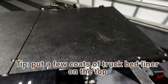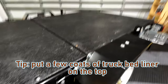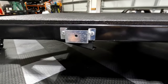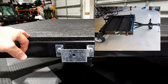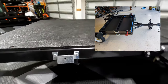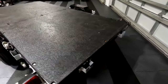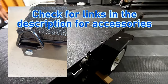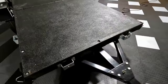For the top I used a few thick coats of truck bed liner. I figured this is the best way to get some longevity out of it, and so far I'm really happy with the results. An important part I missed earlier are the clamps — these are used to attach sides to the trailer, with two on each side and each end. I also added hooks around the outside to use tie downs for any loads I'd be carrying. These didn't come in the kit but you can pick them up on Amazon, and the bolts that came with the kit can be used to attach them.